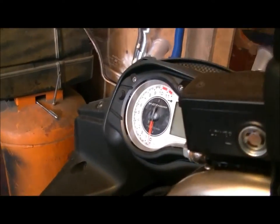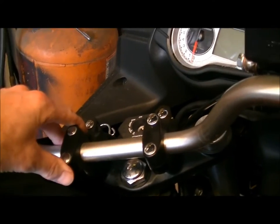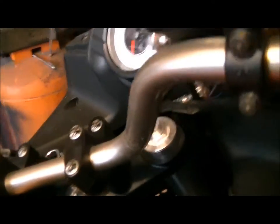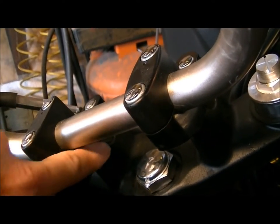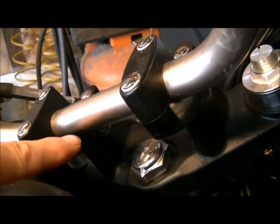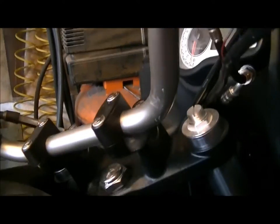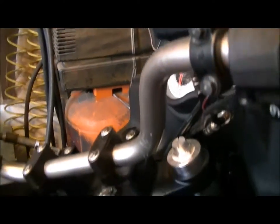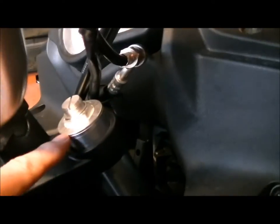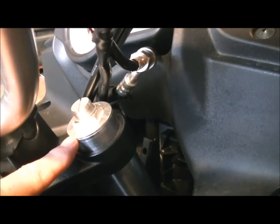Kind of chunky looking things really, but a nice finish to them. They did have to be adjusted right in here — I had to actually file a little bit here and here to get the handlebar to sit down in there. It wouldn't settle in, it wasn't a perfect fit, but that was easy enough fixed. They bolted up really nice and they do come back and up — she really likes that. We also took the forks up five eighths of an inch to match the three quarters on the back. I could have gone three quarters, but I was happy with five eighths.